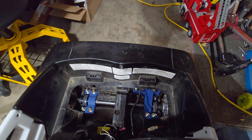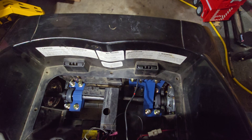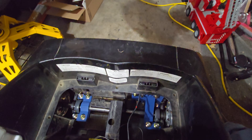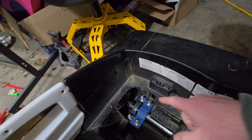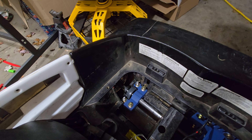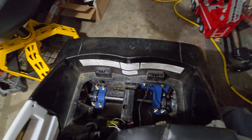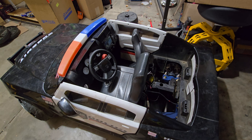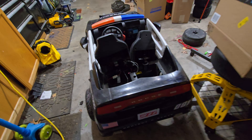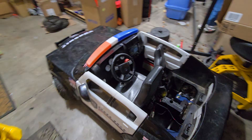It seems to be working. The electronic braking is pretty hard on the chain and sprocket. Once I go to the disc brake, it's going to have a pressure switch that just disables the motor — I'm not going to be using the electronic braking anymore. That's the plan with this police car. I hope you enjoyed this — don't forget to subscribe if you want to see how this thing finishes and how it does reliability-wise. Thanks!